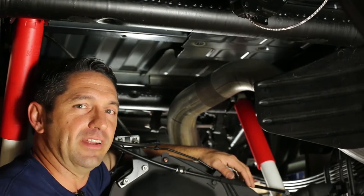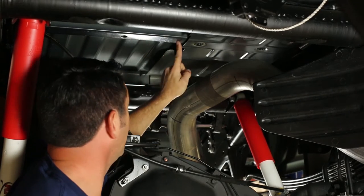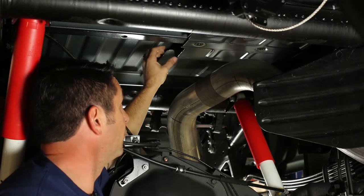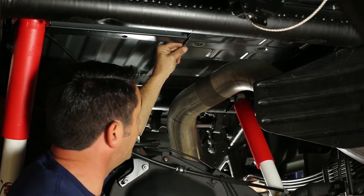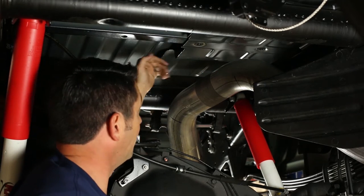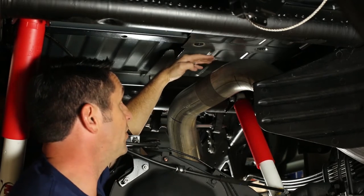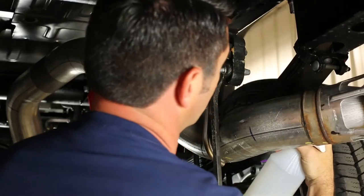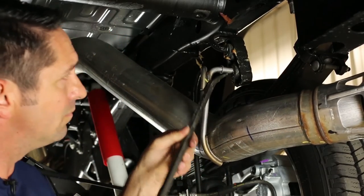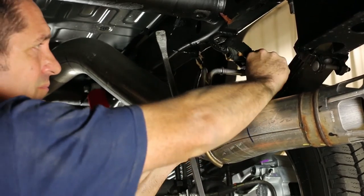The first real step of this installation is to cut this section of aluminum heat shield out of the way between these two bed cross members. This can be done using several different types of tools — we recommend the use of either air shears, a power hacksaw, or a cutoff wheel. Today I'm going to use the cutoff wheel, which requires a little bit of extra clearance between the heat shield and the top of the tailpipe. So I'll be using a solution of soapy water and a pry bar to disengage the rubber hangers on the exhaust, to get it down and give me the clearance I need.